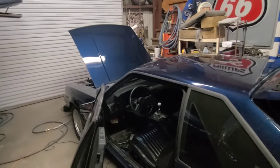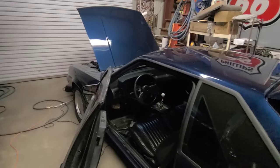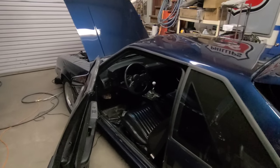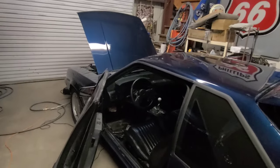And then I thought about it for a second and I'm thinking, God, the car needs vacuum in order to activate. And I haven't even started this car, and I've been playing with it. So I fired it off, which it starts right up, and damn if it doesn't come right out of the vent. So I took apart the HVAC system for nothing.